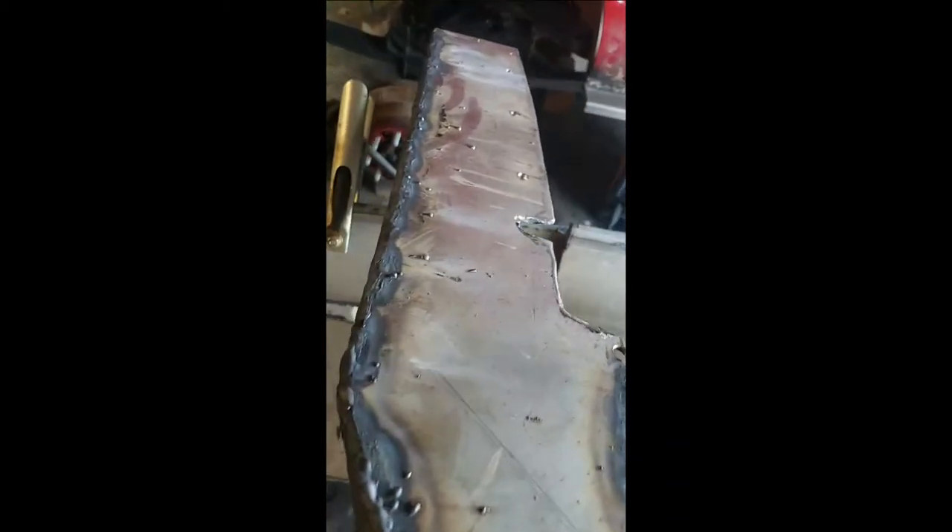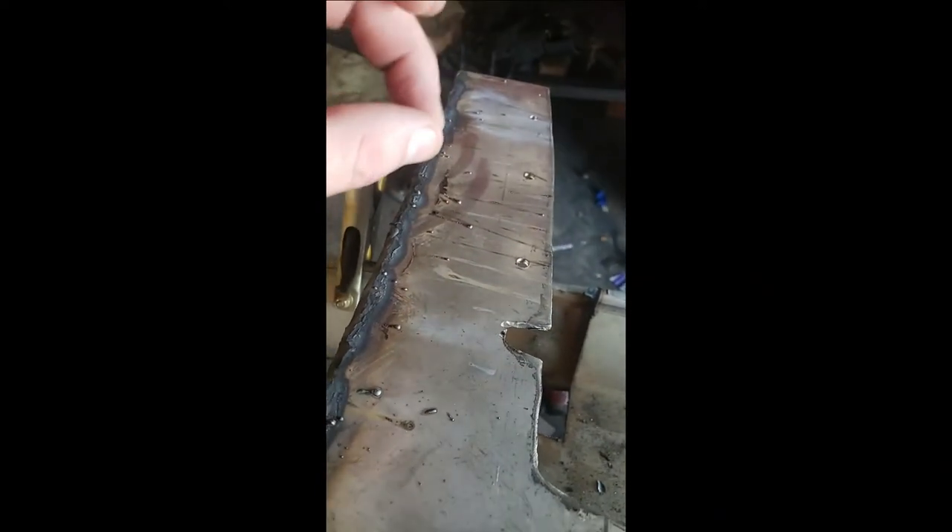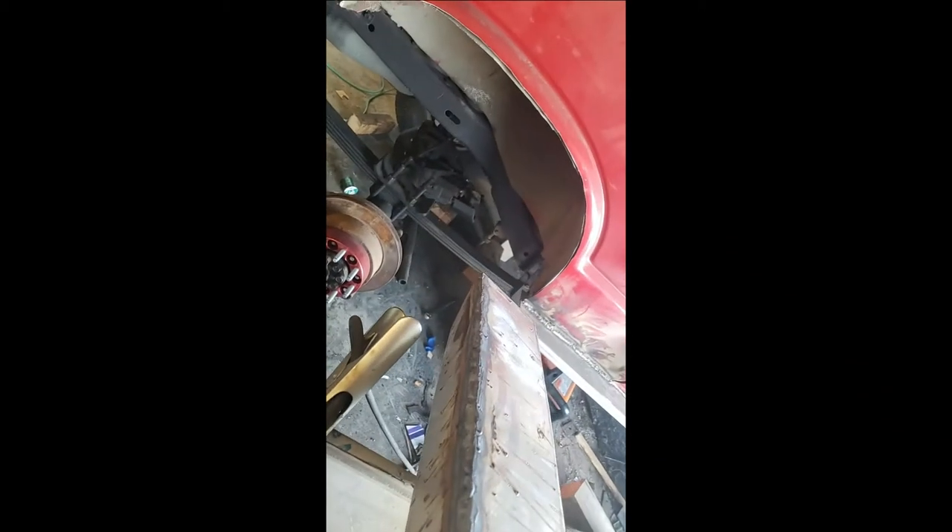Stainless is a little difficult to weld, but I think I'm getting a handle on it. My final review on this stainless welding: when I get it really hot — as hot as that bugger can go — and as fast as it can go, I can get it going very well. See that groove there? I welded on all of the insides, but the outside — see that splatter? There's like a little ball that melts and it just drops in.